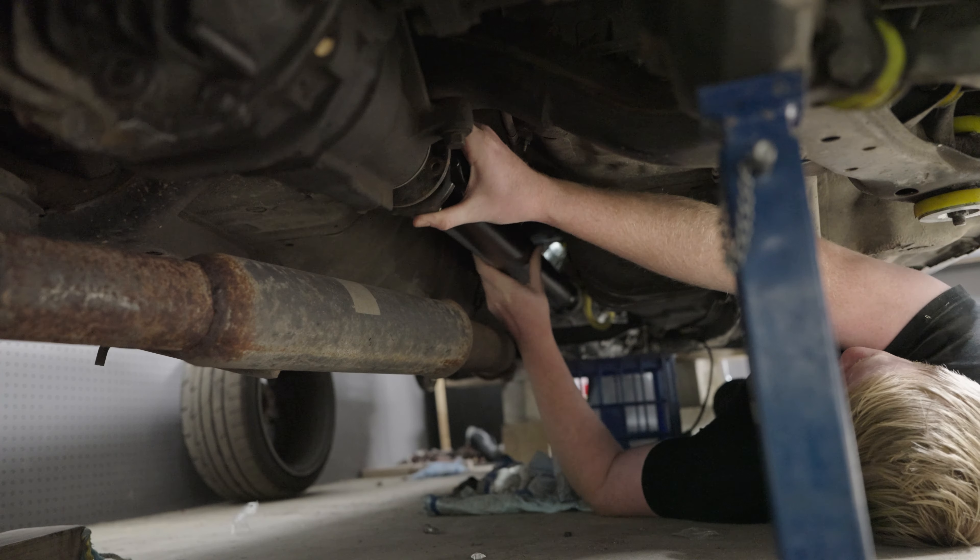I kind of got carried away and just fixed it. What I had to do was take this thing off by cutting a slit down the base of it - which I thought was going to be a lot worse than it was - cut it down to that ring, pull this off, bent two tabs out, pulled the silver ring out, and now I have a little button in there that allows me to pull up to full drift position and then up to tight. Handbrake fixed!